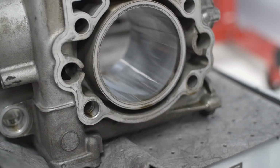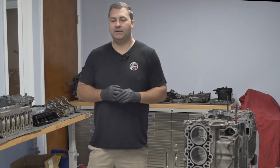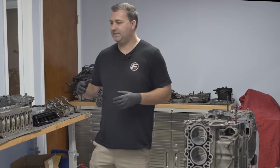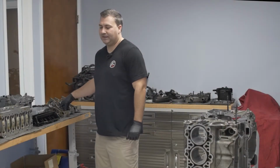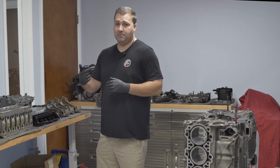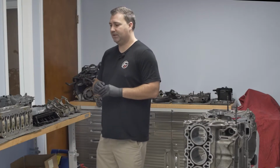So down here in cylinder 3, you can see that the cylinder wall has been marked up. What caused that damage, slight but enough that you would have to redo that cylinder, is on piston 3: a circlip from the piston pin came loose. Somebody had been in this motor and replaced the IMS shaft with the M97 shaft, and when they put the motor back together, the circlip didn't seat correctly. Over time that clip came off, and it was actually still in the motor when it was pulled apart, but the ring on the piston moved over and started marking the cylinder wall just slightly.